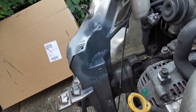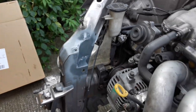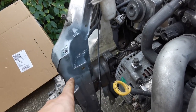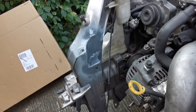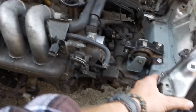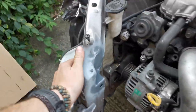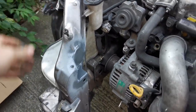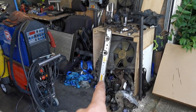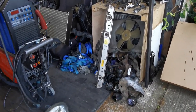So there we go - blown in primer. All that work for a little notch but it's quite cool. Get some seam sealer just around there and that'll make that look good. This is now nice and sturdy again - it's just taking all of that flex that we introduced back out, which is wicked. Now it's just a case of sticking a bracket there at the right height, drill some more holes in the top brace, and that'll be the rad in.